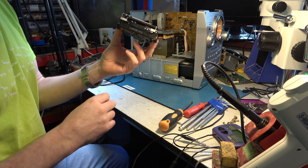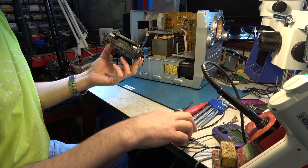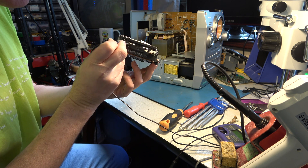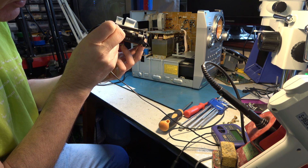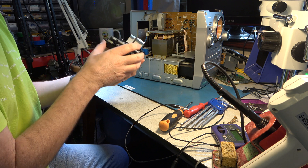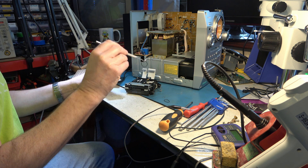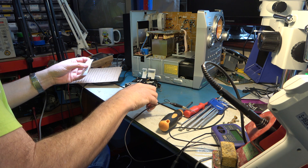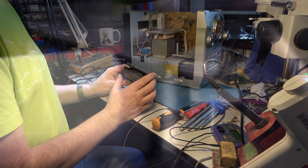So the drive belt in question — you remember — is just there. There's a front and a rear pulley, both white plastic. So we need to pop that drive belt off and fit the new one. A little fiddly but doable. I've fitted that belt and I'll just show you on the microscope what it looks like in its proper position.